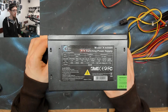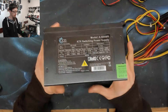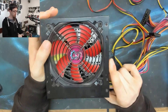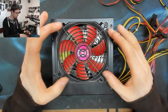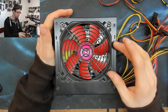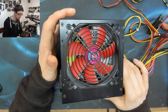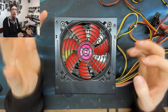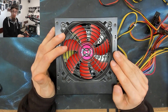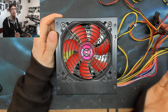You could replace this brand name with basically anything — you could put CIT or Color-sit on it and it'd be the same thing. The fit and finish: firstly, it's not a very heavy power supply, which means the components in there are all very lightweight and cheap. The heat sinks in there are small and weedy with lots of holes in them, not a lot of mass, which means it's going to run hot and things are going to fail earlier.